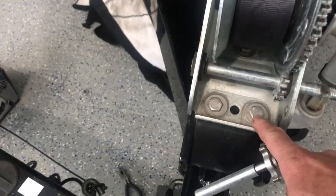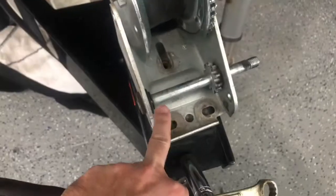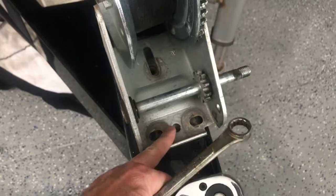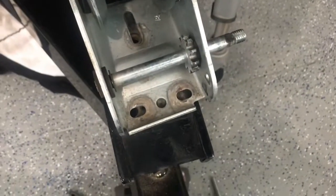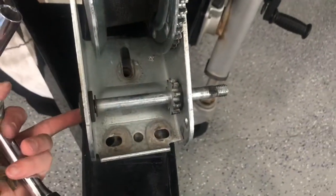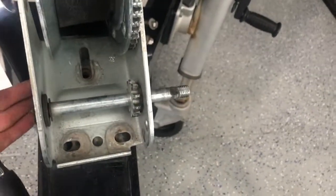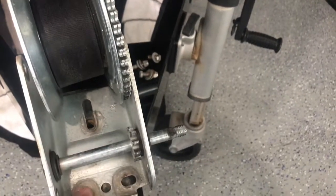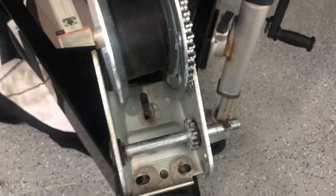If you see, there are two bolts here — two in the front and one in the middle. You just need to get an open-ended wrench in there and take it off from underneath. To remove these bolts, you just need a 9/16 ratchet and open-ended wrench. To get to that middle one, though, the drum has to be out — that's why you need to remove that side bolt. This one you can't access from underneath; it's right into the post, so it's just a screw in there. The others are a nut and bolt.